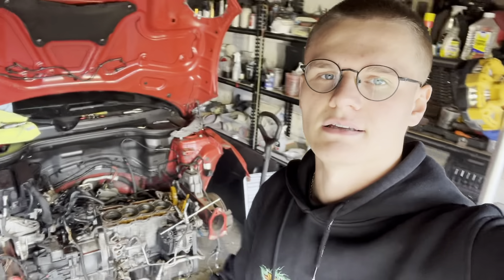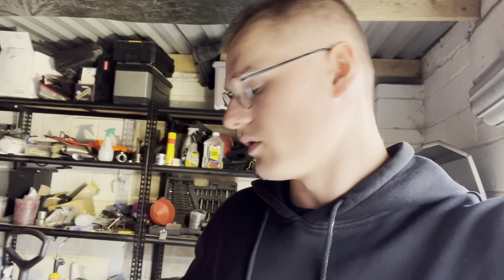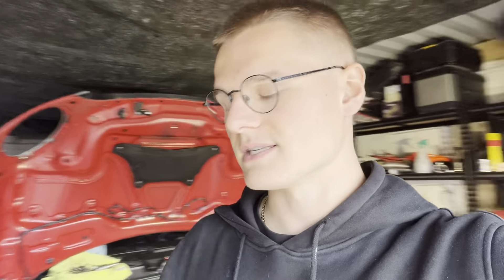Back on the mini the next day. All four cylinders - they've all dropped the water, and I knew eventually the water would drop. I've been in touch with an engineering company called South Wales Pistons, and they basically told me that they need the block and the head to measure the bores and check the valves on the head. That would mean I need to strip the gearbox off, all the ancillaries, take the crankshaft out, take the pistons out, and take the block and head to South Wales Pistons - it's only around the corner - so they can measure and tell me what I've got. There is a slight bit of scoring on one of the bores.